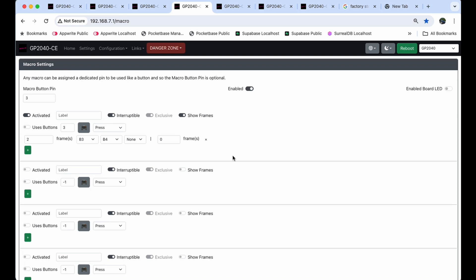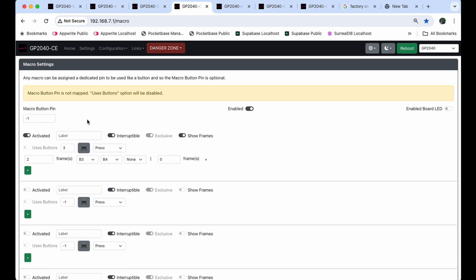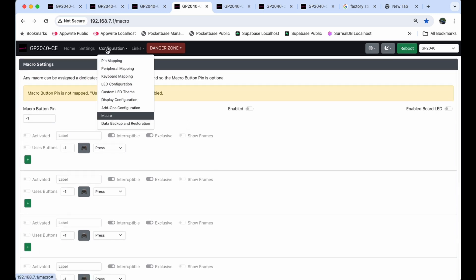Also, when playing a game, I'm unable to hold down any directional (up, back, left, down) while hitting this button — it doesn't work. So I wouldn't really recommend this setup. You can come in and configure Use Buttons and set up different things if you'd like to experiment. But here's the starting point. To reset everything: unplug the device, hold start, plug it back in. Set the pin back to negative one, delete the entry, hit the down arrow to get negative one, turn off Show Frames, deactivate and disable the macros. Everything is back to the way it was — save it.